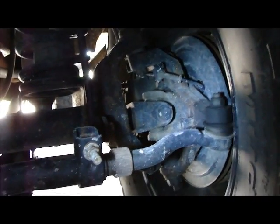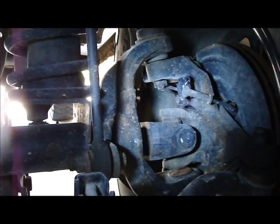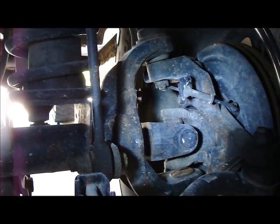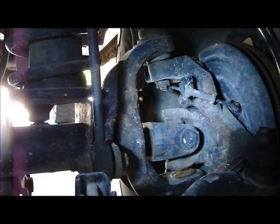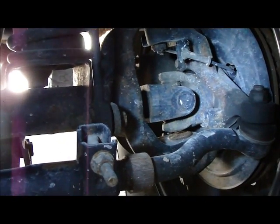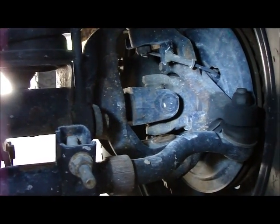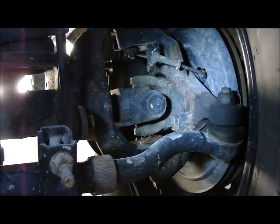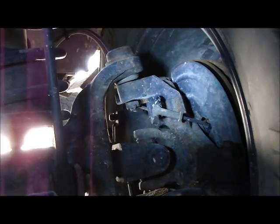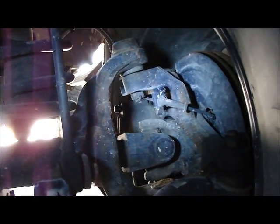That's good, Nelson. Now on the driver's side, the same as on the passenger side, my son's going to grab the top of the tire and vigorously push back and forth in order to check the upper ball joint for side-to-side play, as well as to see if the unit bearing, the bearing that the small outer axle shaft goes through and has studs that you bolt the wheel to. So Nelson, go ahead. So there's no movement there.